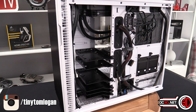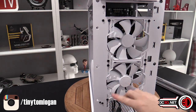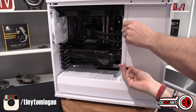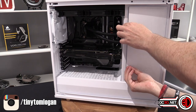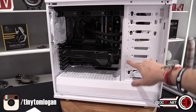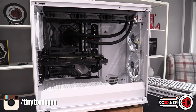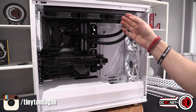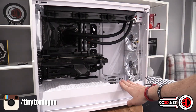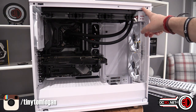There's another trick this case does. There's a panel here held by a couple of screws that can actually be moved across. There's a vanity/dress plate that literally just covers up the holes. If you leave it in its original position, you can mount hard drives there. If you remove the other screws — which takes a moment as you need to remove the AIO from the roof first — you can move the plate over. There are two screws in the bottom, two in the front, and two up top to secure it in the new position.